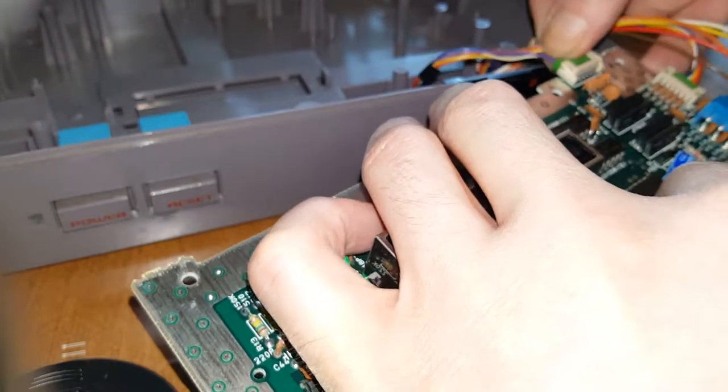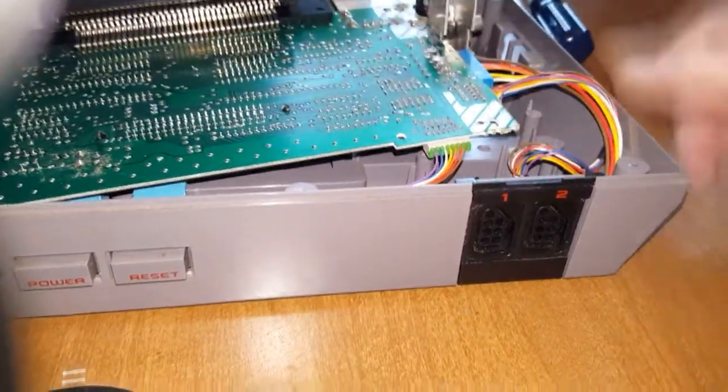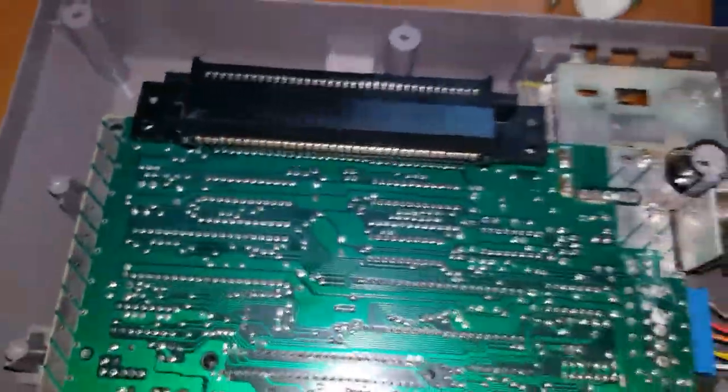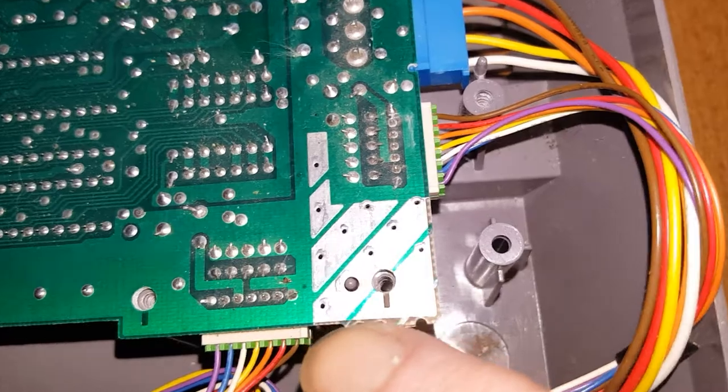Once you've got those cables reattached, the board flips back over so we've got the cartridge port side up. Take the RF port — we've got the stuff sticking out there and a hole in the shell for it — just lift up your board and tuck it into place. If you set it in the right spot, it should sit right back into its original location. Wiggle it around a little bit and it's locked in. If you've got it in the right spot, you can't move it out of place unless you lift. Screw holes are going to line up in the corners — everything's good to go.